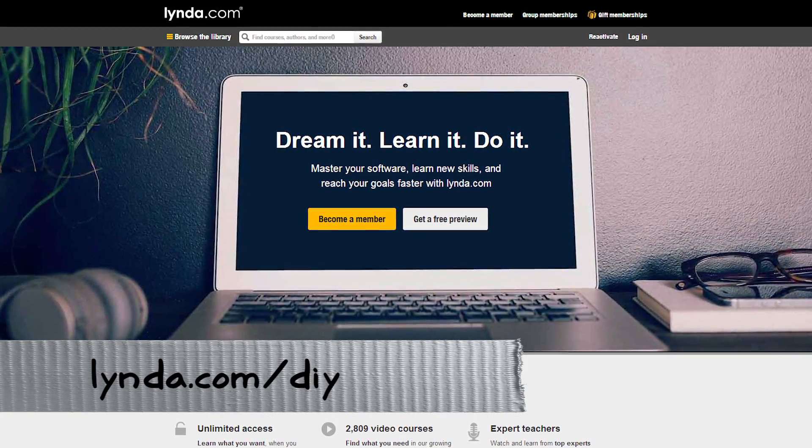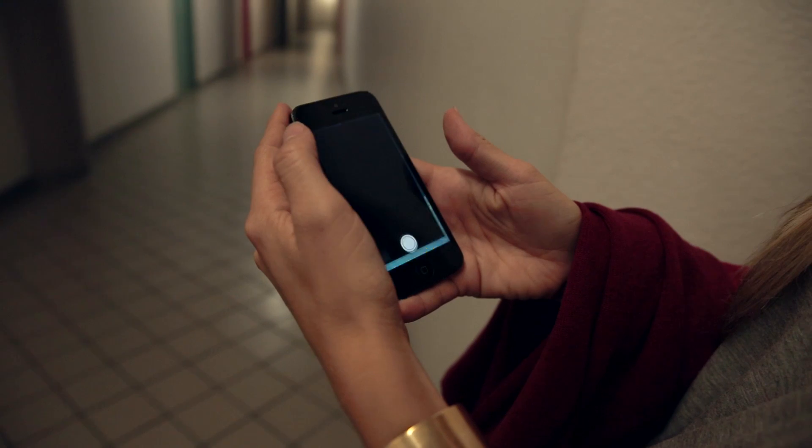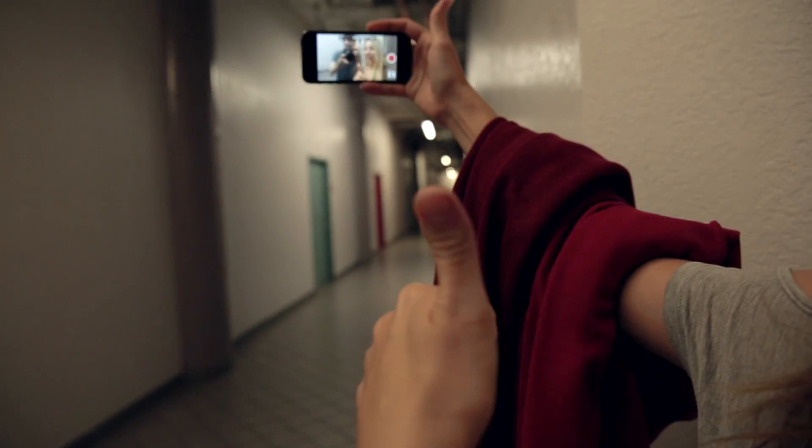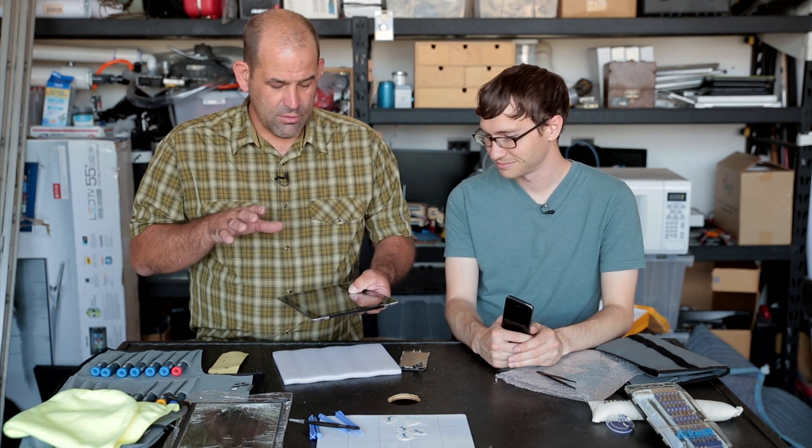We want to thank them for sponsoring this episode of Die Tryin'. After jiggling a few wires, I was ready for Kendall to try out the iPhone again — camera working, selfie working. iPhone 5 is like two screws and then some ribbon cables if you have the complete front assembly — so easy. The Microsoft Surface, okay, eight of you own that. iPad 2s, many of the iPads, a bunch of Samsung devices, Motorola Moto X, Moto G — all have glue on screens. And the glue was a nightmare, because you have to heat the glue, remove the screen. In the process of removing the screen, we tore off the Wi-Fi antenna and broke the home button. Glue on screens suck.